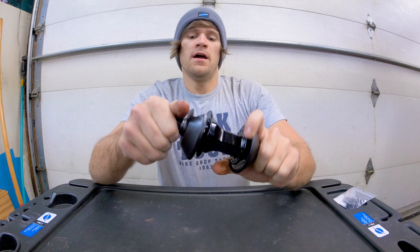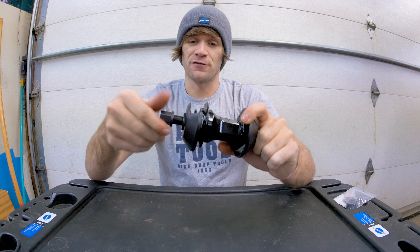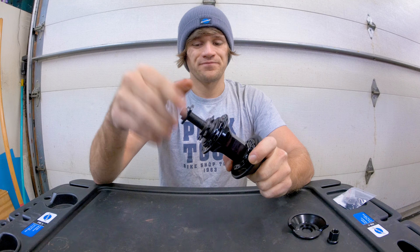In order to explain this we need to take this thing apart. The Alienation Venus free coaster hub is available now at most BMX mail orders as well as local bike shops that work with JMB Importers. I helped design this free coaster as well as give it its name, and I'm so excited about that. We're going to take off the hub guard that goes onto the hardware on both sides, taking the drive side off so we can get to the internals. We're taking off the drive side jam nut right now.